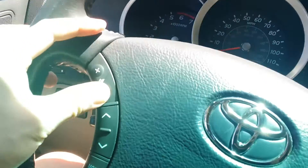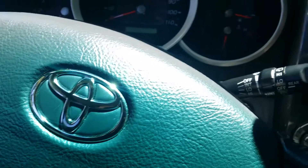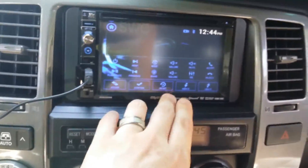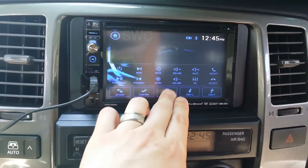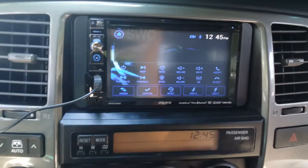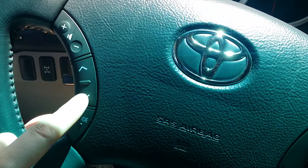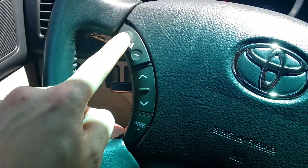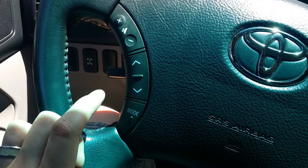As I press these, nothing will happen right now. Go ahead and hit the reset to clear anything you might have had on there; if nothing is on there, reset to get it ready to go. Then locate your steering wheel control buttons and press them one by one. Do make a conscious note of the order you're pressing them, because that will affect you later. I have five buttons, so I'm pressing them one by one.